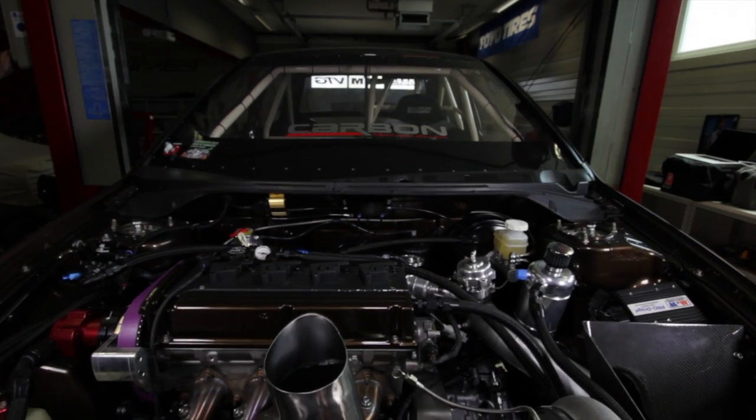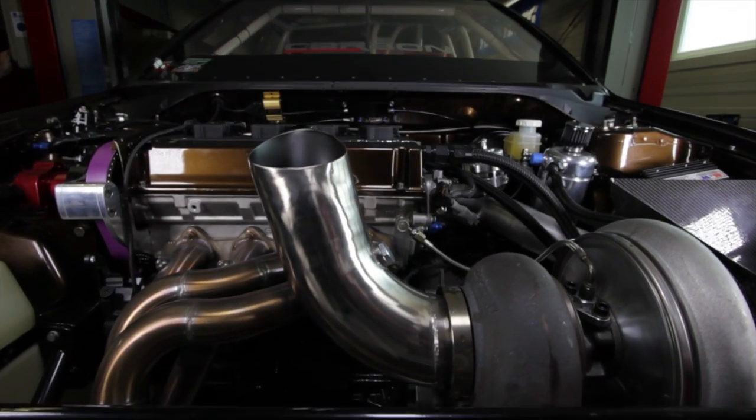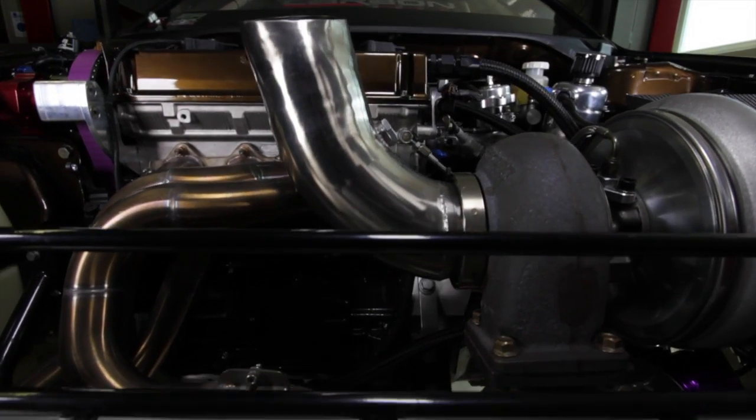This is the heart of Paul's car and I thought I'd go through some of the componentry and explain what it does and how it works. We'll start with the engine which is a custom-designed drag specific engine by STM. It uses a Mitsubishi 4G64 block with a custom billet crankshaft, aluminium forged rods and high compression aluminium JE pistons to give a total displacement of 2.1 litres.